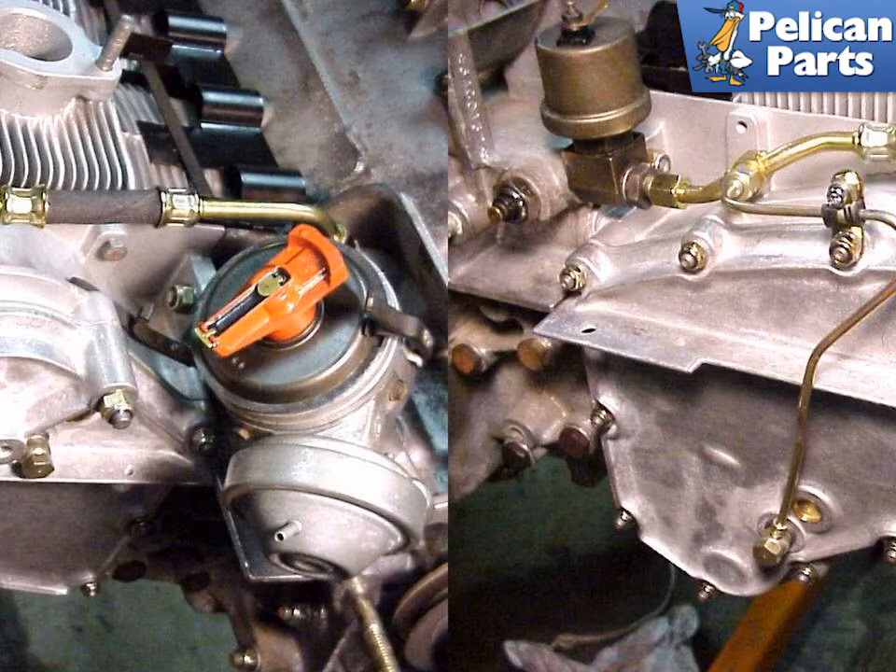Remove the wheel by pressing out the small expansion pin. Installation into the new shafts is straightforward, but make sure that the open edge of the socket shaft is installed facing up in order to catch oil for the lubrication of the idler sprocket bearing. Make sure the chain doesn't come off the cam gear when replacing the idler pulley, otherwise you will have to re-time the cams.